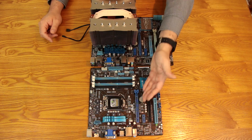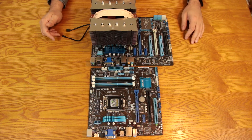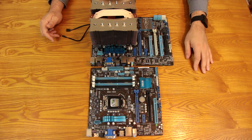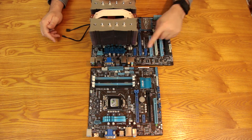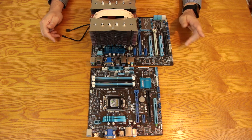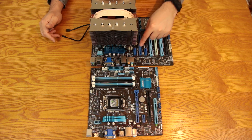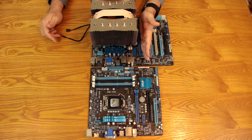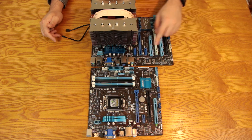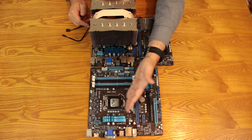The PCIe X16 slot on the micro ATX board is in almost the exact same place as the PCIe 1X slot on the ATX board. So if you have two PCIe X16 slots and don't plan to SLI, you can just bump down to the lower one. You want to make sure your motherboard has something populating the top row, like a PCIe 1X. You don't want any components touching the metal on this cooler, and you don't want to be pumping heat back from your graphics card. Apparently Noctua is working on a design that scoots everything forward so you won't have those clearance issues.